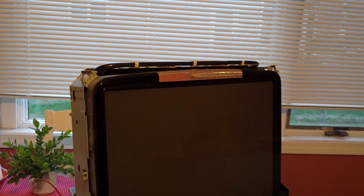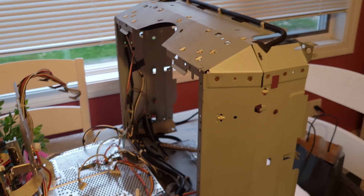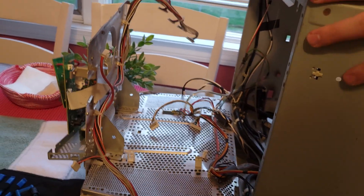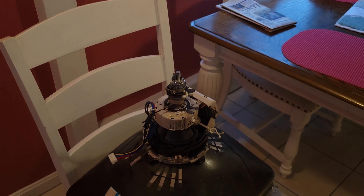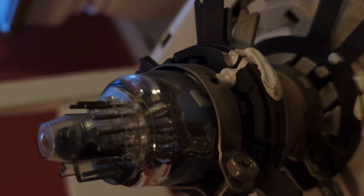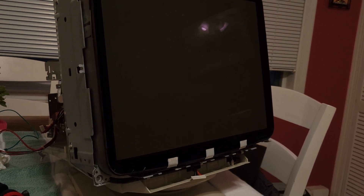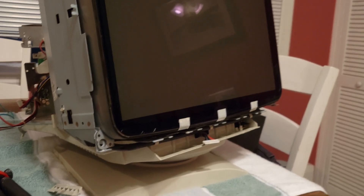This is the tube — it looks very hot, very attractive. It's very nice looking when it's naked. Looks like spaghetti with all those cables. It looks very overwhelming, but it's not really because a lot of that stuff is just cables you don't need to touch — you just need to plug everything back in. That's the old tube right there. We're going to take a good look at her. The label reads M50RB-15X. That's our little pins. And this is the new tube put back in — the old tube sitting in the monitor, and with the new tube now installed.